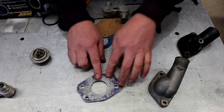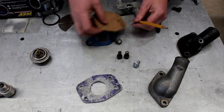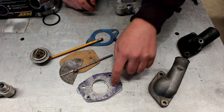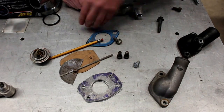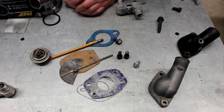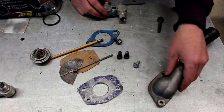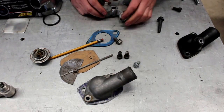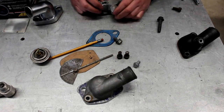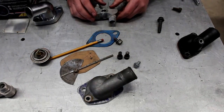It's spaced up three-eighths of an inch, it's got two extra bolts, and it will take an extra gasket — but all of these parts I had sitting around. It took a while and more than one try, but in the end I've got a really good product. The outside was cleaned up with a belt sander. This was created with cardboard, pencil, and a protractor. The center hole was done with a hole saw in the drill press, and the small holes with a cordless drill and hand-tapped. So this didn't take a tremendous amount of tools or technology. This beautiful part from Summit Racing will have to go back — my bad — but they have a very good return policy, and I got to make a custom part.